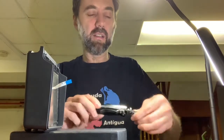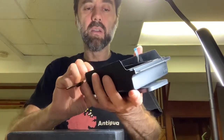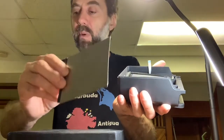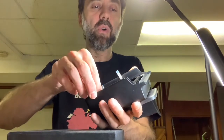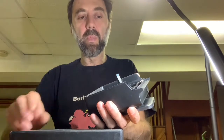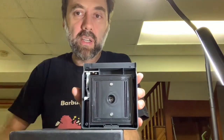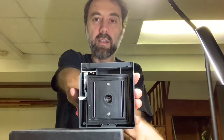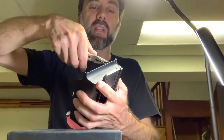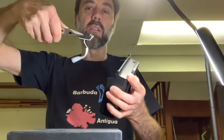Inside we have the dark slide, which we'll be reusing. When you take it out, slowly angle it downward and it will come off. You'll see the two plastic tabs — we need to do something with those. Also — update — there are plastic spacers inside: do not throw these away, we'll be reusing them. You can see the eject board electronics with the ribbon cable plugged into the other side. Take it out using solid tweezers; grab on the side, wiggle it out, and it's done.